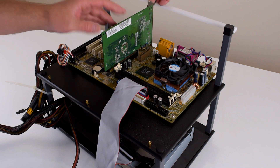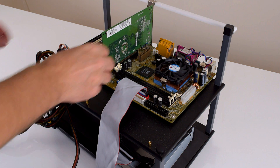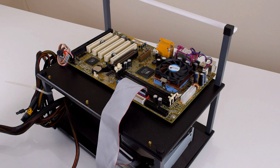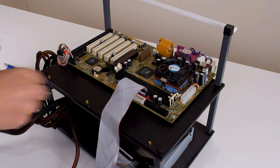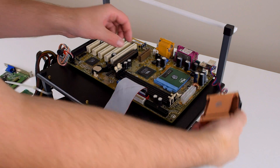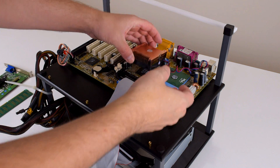So the motherboard — there's no need to swap that. An Intel 815 chipset motherboard is probably more stable and it might be a tiny bit faster, but it's not much, and swapping motherboards is a hassle and you might have to reinstall Windows. So we're gonna stay with the same motherboard.